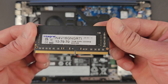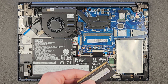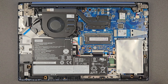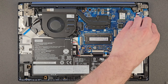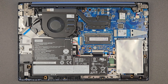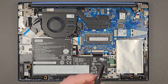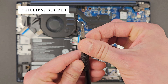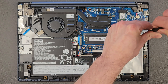I'm gonna swap that to 16 gigs, so in total we're gonna have 20 gigs. Great news — sadly only one upgradable RAM bay, but still good enough. I'm gonna leave links in the description for the RAM so it'll be much easier for you to find. We're ready for the solid state drive upgrade — it's a smaller form factor drive, but don't panic, we're gonna install a normal size solid state drive there. That's the Phillips screwdriver — the size shown here shouldn't matter much, it will still work.